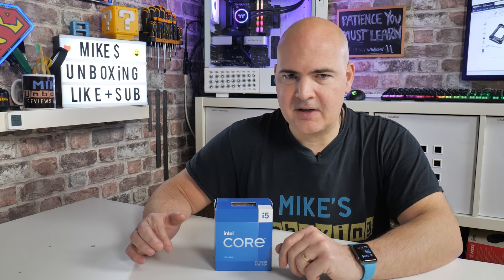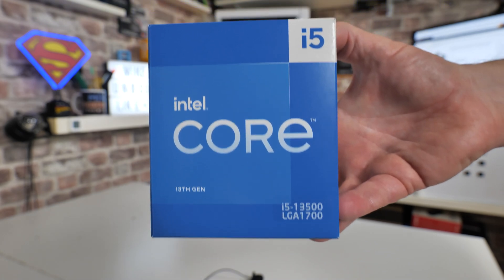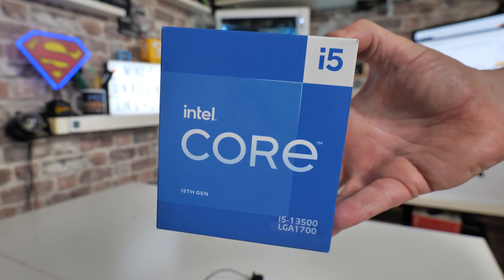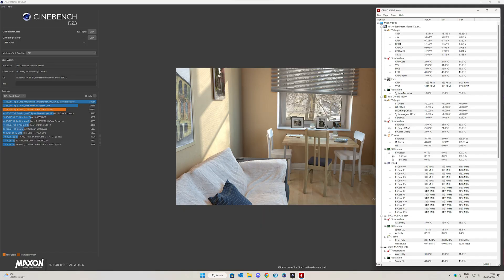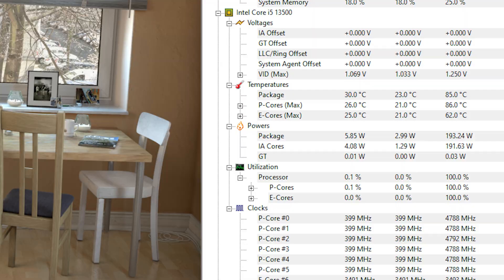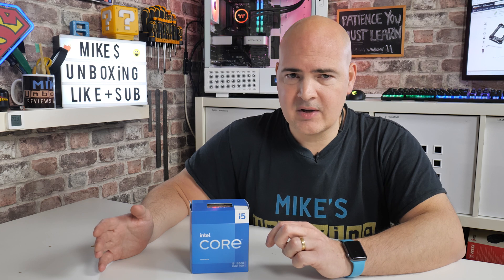Next is the first test with the contact frame installed on our i5-13500, running exactly the same tests again. I don't believe there were any Windows updates overnight from what I can tell in the system logs. The first test I ran, the CPU was getting closer to 90 degrees Celsius - at least 10 degrees hotter, which is extremely unusual. I put this down to possibly the thermal paste application or something along those lines. We got basically the same Cinebench score give or take a few points, but the wattage had peaked up nearly 30 watts higher.